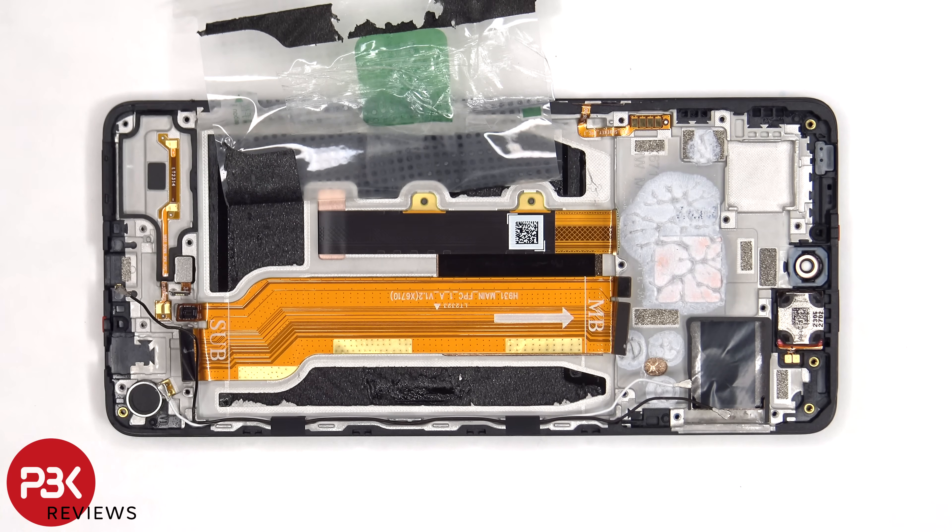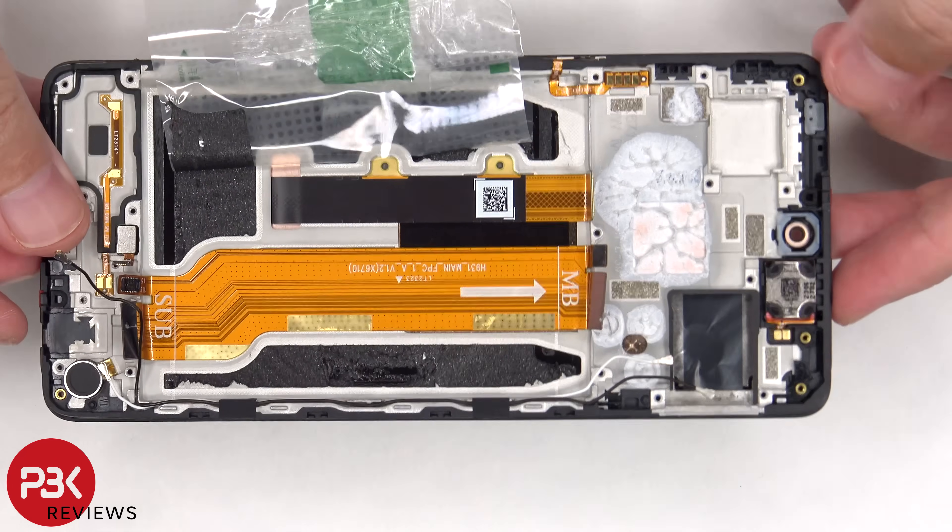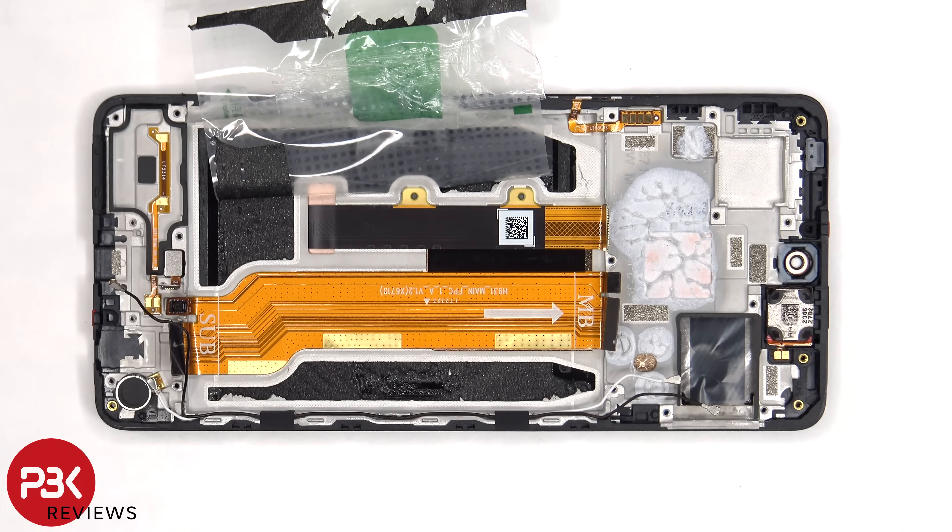If you needed to replace the screen, you'd have to remove the back plate, the screws on the back housing and the back housing itself. You'd then have to disconnect the battery cables and pry the battery off, as well as peel off the battery adhesive pouch, and disconnect the screen cable from the main board. At which point you'd heat up the front of the phone where the screen is to loosen up the adhesive underneath. You'd pry the old screen off, apply a new adhesive and reapply the new screen, making sure you run the flex cable back to the opening in the mid-frame, and reassemble the phone.